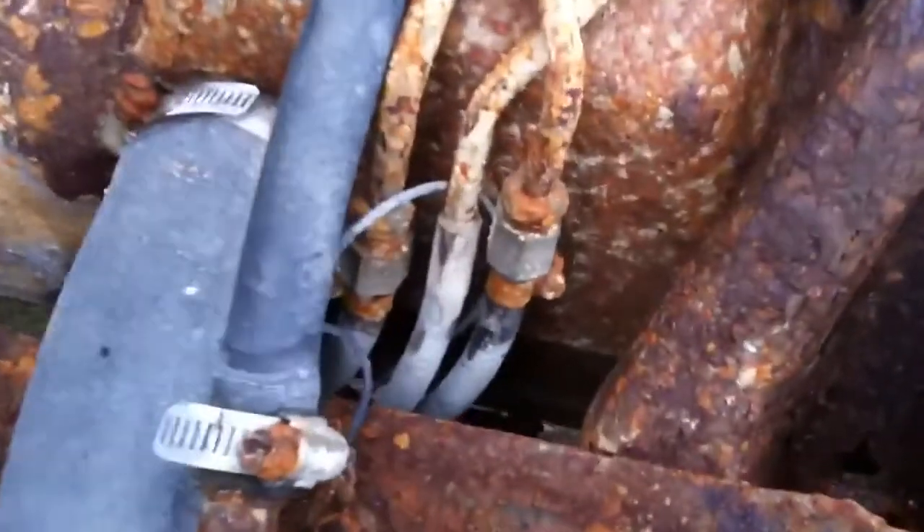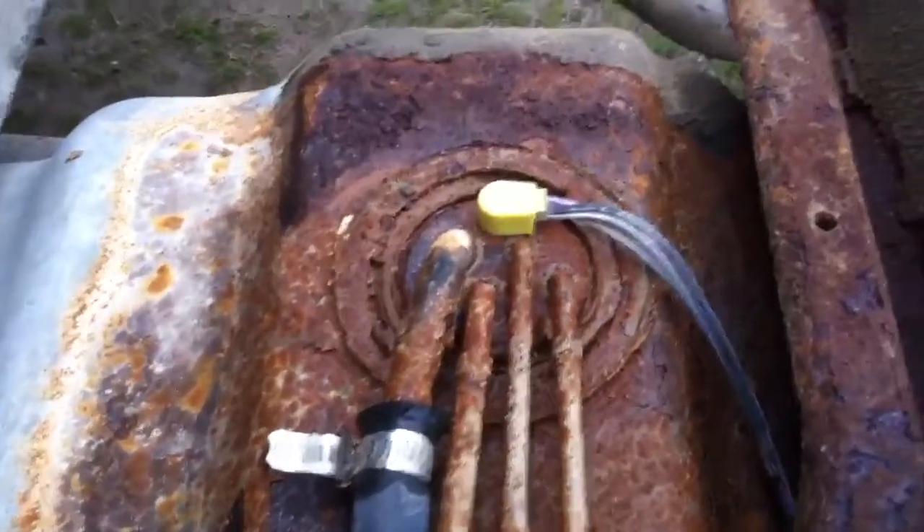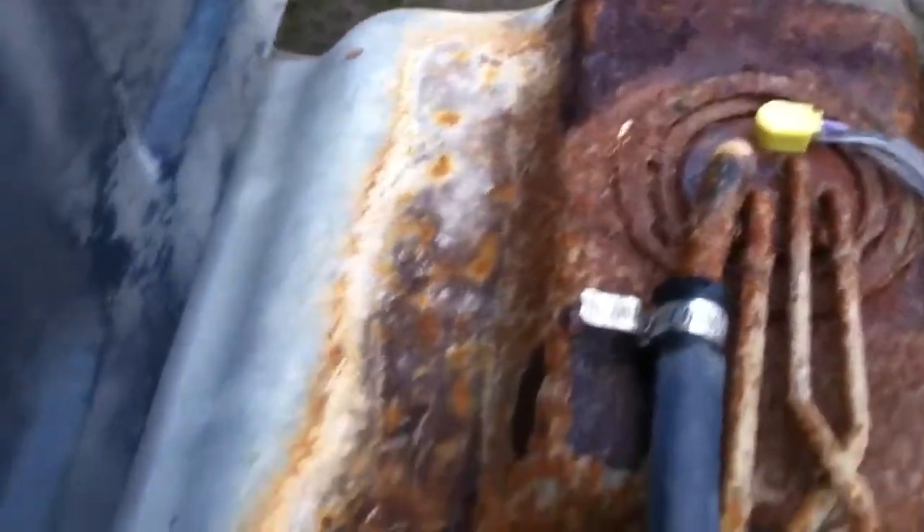As you can see, if you look there, you can see the stains on the tank and they're directly under this crossmember — so by process of elimination, there's the leak. But yeah, the whole tank looks like hell anyway, the sending unit looks like hell, so whatever — just change her all I guess. We'll come back in a second and I'll show you where those clips are for the wires.